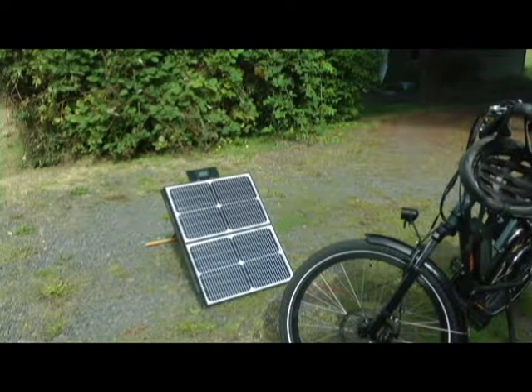I generally use the solar charger when the bike is at home and just keep it off the bicycle, although it can be mounted on the bicycle as I'll show you later. It would extend your range about 10% in normal use. With it off the bicycle, if I just come home and charge it, it supplies all the energy that I need for the bike for the course of normal use. If it were on the bike, it's only going to give you probably five to ten percent more range with continuous use, but it does charge the battery up all the way. It charges when it's parked, and it charges when it's off the bicycle.